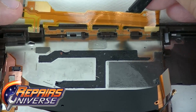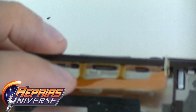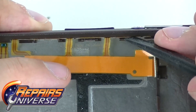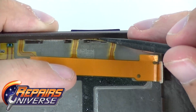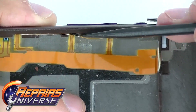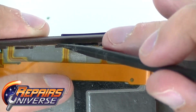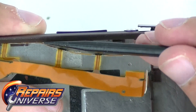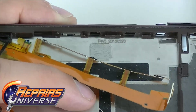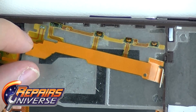Once we have them up, the best way to get into it is to flip it back so you can see a little better. Bend them back a little and start where it's inside the connection. Once you get it started, you can wiggle the little pry tool to get some of the adhesive off. Once you start getting it going, you'll notice that it slowly pulls away. We just took apart the Sony Xperia Z and removed the volume flex.